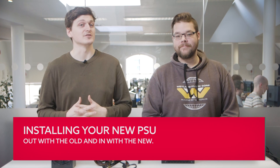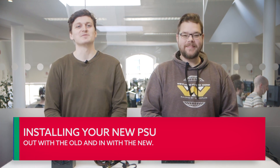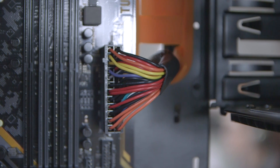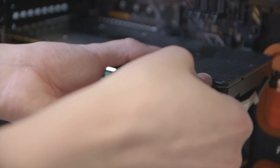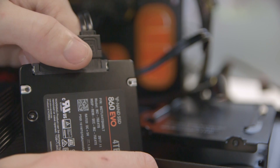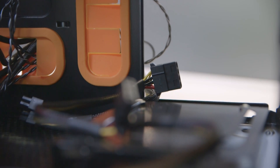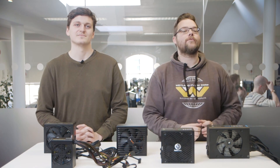So now that you've picked up the best PSU for the job — obviously an AI-controlled RGB PSU — it's time to install it in your system. It's normally a pretty simple job to swap out your old PSU and put a new one in, but it's a lot easier if you know exactly which cables need extracting first. You want to disconnect the motherboard ATX 24-pin, the CPU 4-plus-4-pin, your graphics card power connectors — which could range from a single 6-pin PCIe to a dual 8-pin connector — plus the power cable for every storage device inside your case. You could also have a few Molex connections from your current PSU — these power plugs are a little old school nowadays, but check for any of these before ripping that power supply out.